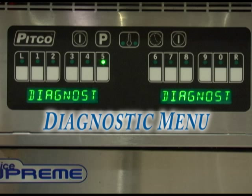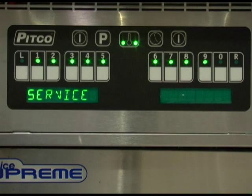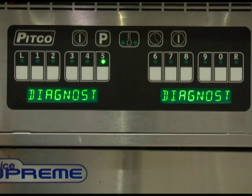The diagnostic menu is used to determine the functionality of controller outputs and inputs. By exercising each output and examining inputs, a determination can be made if an appliance problem is controller related. In the diagnostic menu, product keys are assigned specific inputs or outputs. All outputs in the on state should produce 22 volts DC at the appropriate pins on the controller connector. Controller inputs can be verified by the on or off state of the indicator above the product key. This section will detail the process of checking each input and output. Refer to the level 3 training module on how to enter the service menu, then press key number 5 to enter the diagnostics menu.